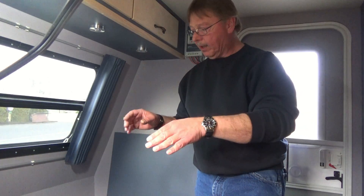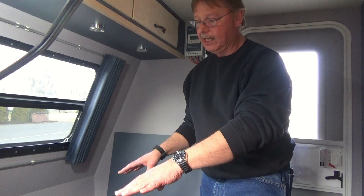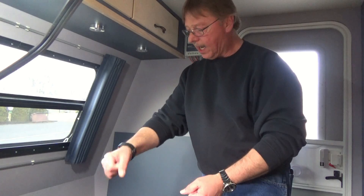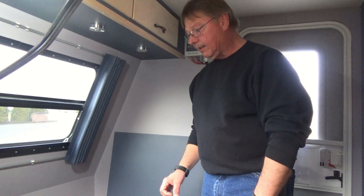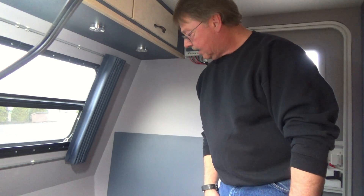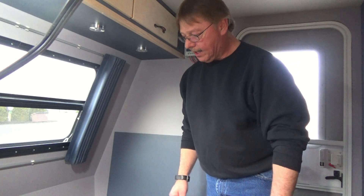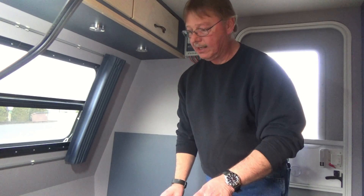Today we are going to run the two-AWG wire. We're going to shut everything off — the solar, the batteries, everything going to the distribution block — disconnect the battery, run our cable, get our length cut, install our lugs and heat shrink, then reconnect everything and put the batteries back in the battery boxes. We still have to run a positive and negative to our bus bar.